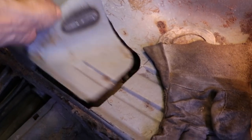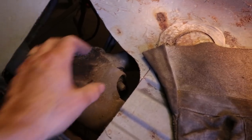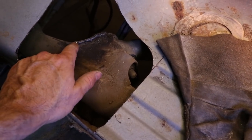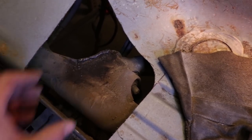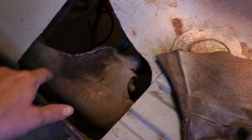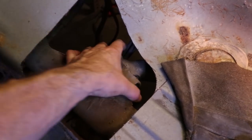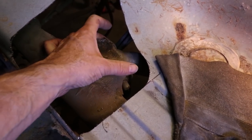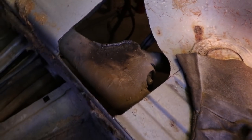This is the area that I wanted access to. You can see this is the bolt that holds the trailing arm in, and this is the weld that I made for my first reinforcement — I cut through it with the plasma cutter. So this will get cleaned up and then a box is going to get added to this area. It's going to get boxed in like that and also have a raised section so that this bolt can be relocated into three different positions: stock, medium, and even more severe as it goes up.